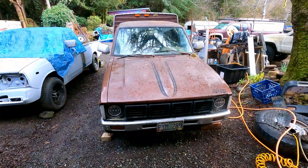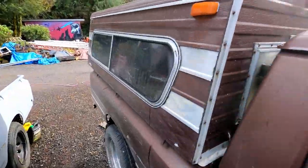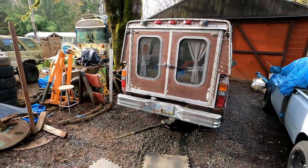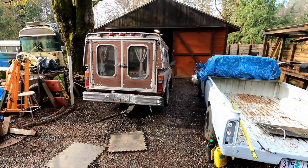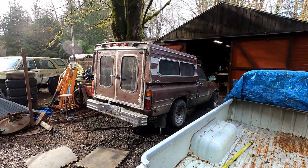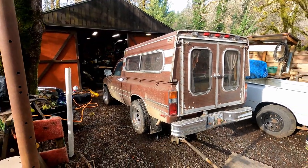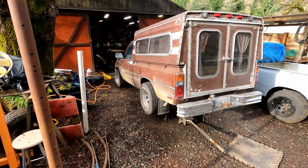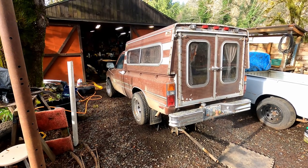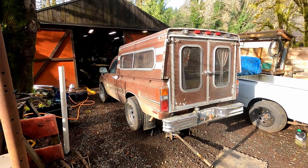What's up, internet — Shihiro is back under the knife. I've been having issues with her, as you guys might recall, and I jumped back into it the other day after fixing Charizard and getting some motivation. I had some small successes with some other Toyotas, so the vibe was good. I went to fire her up — she fired up, idled, and when I put her in gear after she was warmed up, the oil pressure didn't blow the oil filter like it's been doing. I put a Toyota filter in, by the way, hopefully that'll solve things rather than that NAPA Gold. So it warmed up, I put it in drive, and immediately — no power.